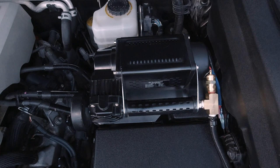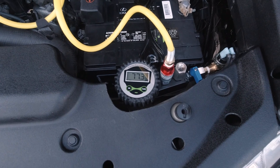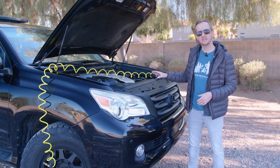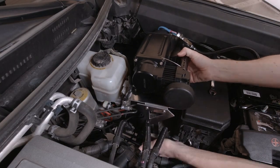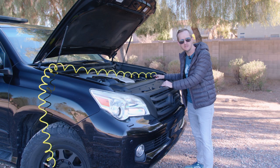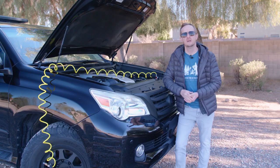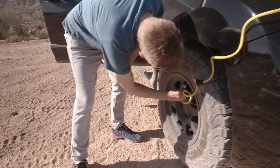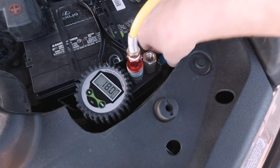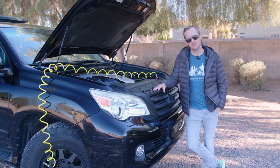Currently my system is made up of the air compressor, the mounting tray, and the manifold. The manifold is what will allow you to add all the valves and connectors to make the system more functional. Everything is stored under the hood — the compressor is permanently mounted in the engine bay, the gauge, valves, and quick connectors are all mounted to a manifold at the front of the engine bay, and the hose with air chuck stores neatly in the space between the battery and the fender. This setup allows me to pop the hood, connect the hose between the manifold and tire, and then control the whole process from the front of the car without having to hold onto anything or bend over to constantly check an air gauge mounted to the airline.